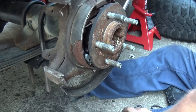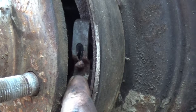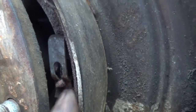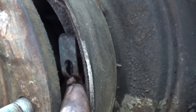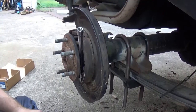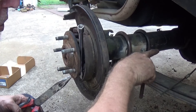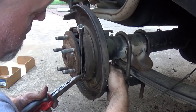Here's what's going on — that little clip right here. What happens is you've got a nail right here, and the head needs to slide up through this bigger hole. It's in the small slot, kind of like a keyhole type situation, like when you hang pictures. What needs to happen is pushing that inward and sliding it downward — or rock the nail up and let it come through the bigger side of this slot, and they'll pop right out of there. You're on the back side here to keep it from pushing out, because it's in this backing plate. Whenever you push this spring in, hold that this way, and if you can get it just right you can rock that pin upward.